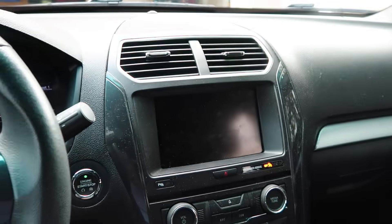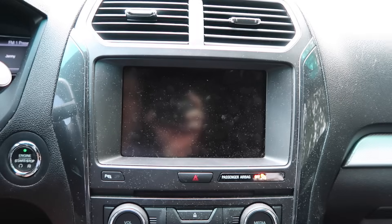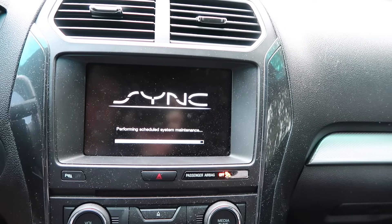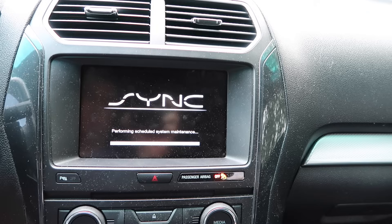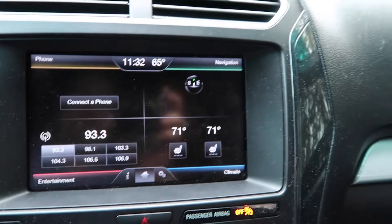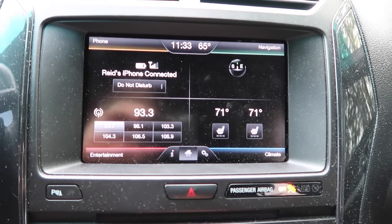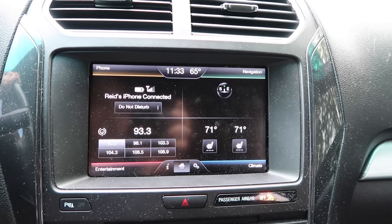It's going to write it — that's good. Your screen is going to go black, so don't be alarmed; it will come back up after a little bit of time as it's basically just rebooting Sync. Now it's got Navigation at the top, and it's going to say Insert SD Card because I don't have it inserted — go ahead and put it in and it should read it.